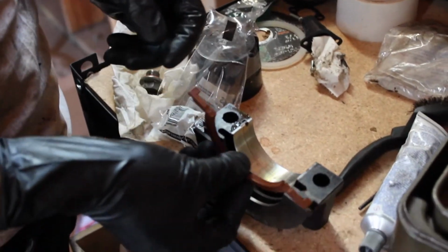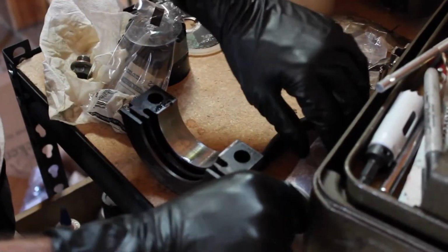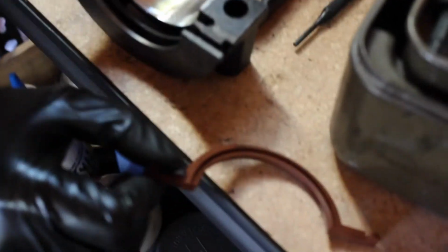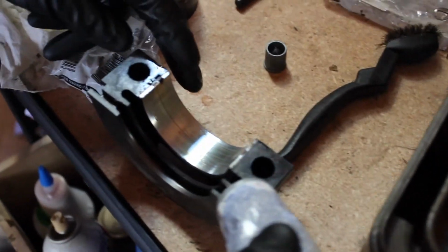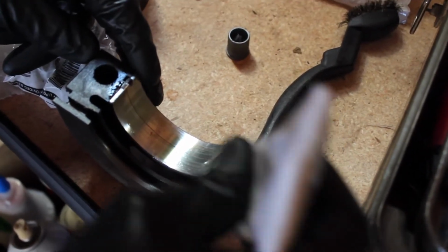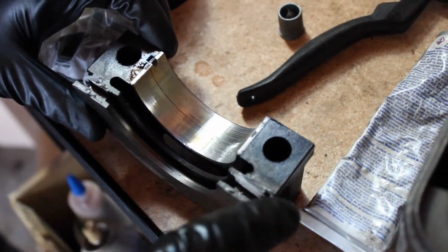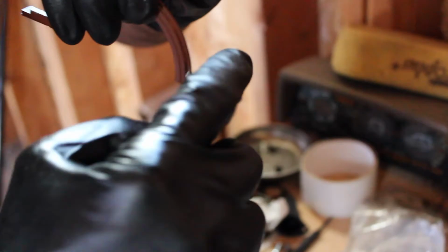So, we're gonna do the top side or the bottom side of the rear main seal. It only goes in one way. See these little grooves? You can't put it in backwards, otherwise it won't seat. So it should be okay. I'm just gonna do the tops. So I'm gonna do a little tiny bit of gasket maker up top here and up top here, and then I'll actually do it on the top side of this surface as well. Very, very thin film I'm going for here. I'm just doing the underside of this, probably the most prone areas to leak.